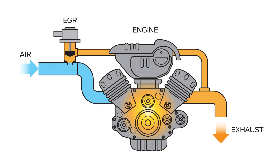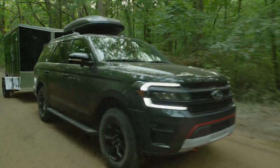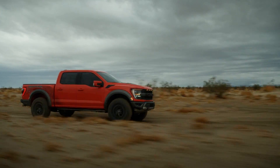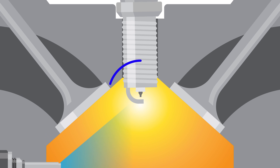This equalizes the combustion between cylinders and maximizes fuel ignitability with air-fuel mixtures diluted with exhaust gas recirculation, or EGR. With traditional spark plugs, high amounts of EGR can inhibit flame kernel growth and slow down burn rates, unless the ignition system efficiency is improved, as it has been with indexed spark plugs. With indexed plugs, introducing higher EGR reduces pumping losses and increases energy transfer efficiency, which in turn helps optimize fuel efficiency and mileage. In engines designed to use indexed spark plugs, using any other type of spark plug will result in the plug having the wrong orientation and missing the window of acceptable combustion.